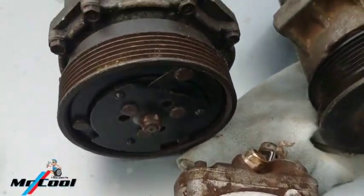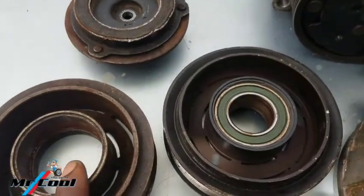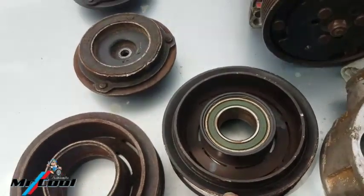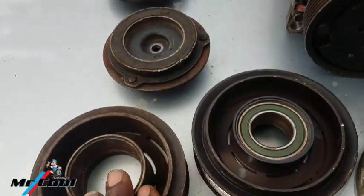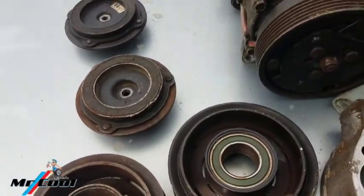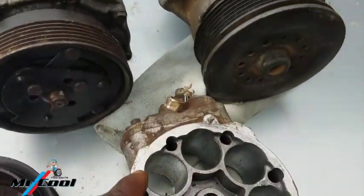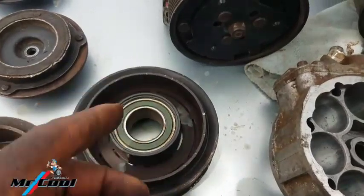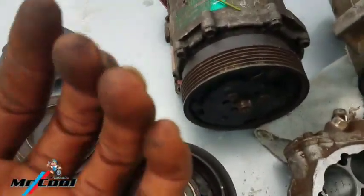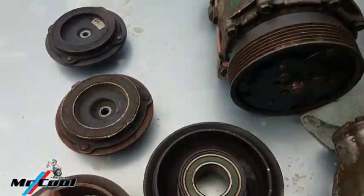So on the first cause — a bad bearing — you can see here we've removed the bearing and put it to use elsewhere since some of them match and some don't. If you have a car where you give the AC command for the compressor to engage and you start hearing a rattling noise, one way to determine if it's the bearing or a structural failure is to notice how the system is performing. If the cooling coming out of the vents doesn't stop being cold and it's still very cold, there is every 90% chance that what you have is a bad bearing, which is a less expensive fix.